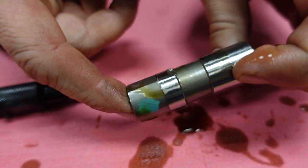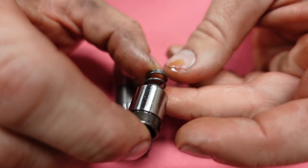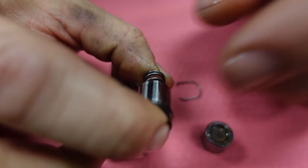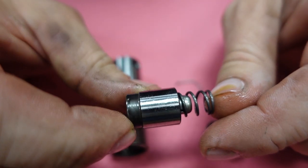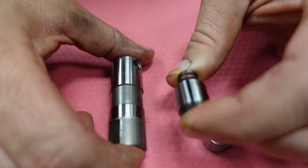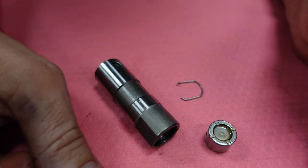Now I'm going to clean all the oil out of this and be right back. What we've got to do is make a spacer to take up the slack. I measured it — I need 1 inch 160 thousandths, or 1.160 inches, of spacer to take up this part of it so I can make this solid. Luckily I have a lathe and I'll show you what I do.